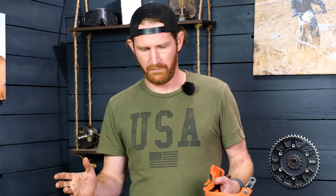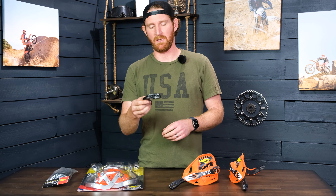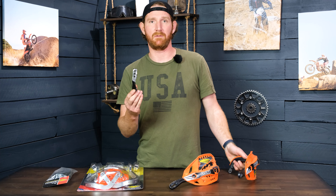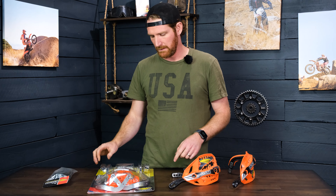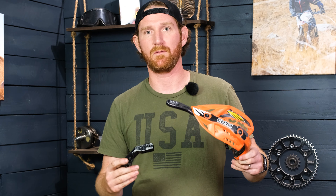I have a couple of thoughts. There are two different versions of these if you go to buy Cycra handguards. These are the HCM versions, which means they come with mounts that mount to your bar mounts — they replace the caps on top of your bar mounts. The other version, the CRM, wraps around your handlebars and has a tendency to rotate down if you drop the bike. With the HCM mounts, since they are bolted and can't rotate, they keep the handguards from rotating down.